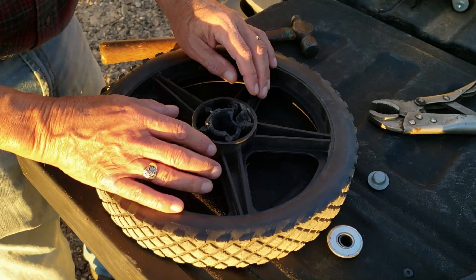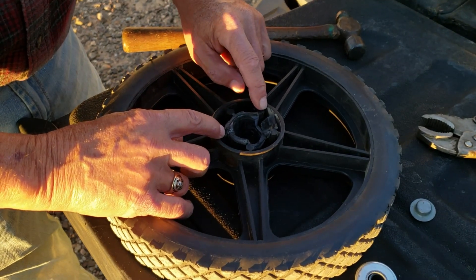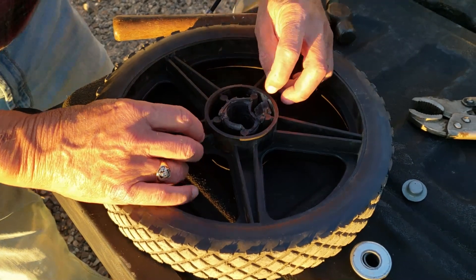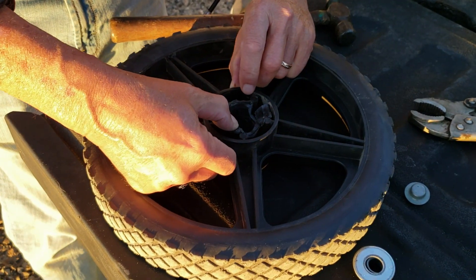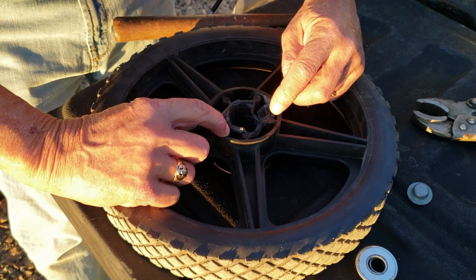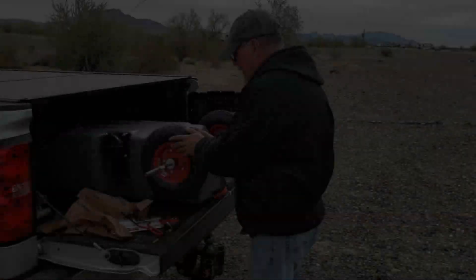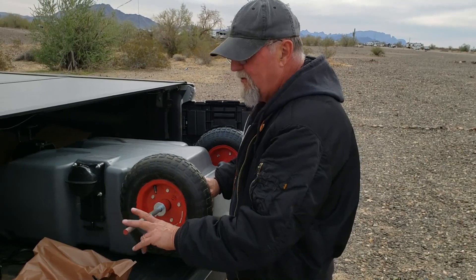I know this kind of stuff from mold design — I was involved in the plastic industry. They have five supports here, and if you look at them, this one failed. I can move this — see how it moves? What's happening is because there's no support in these areas, the stress causes the plastic to yield beyond its yield strength and it fails. I found parts in town at Quartzite — I had to run over to Blythe, California to get an axle.